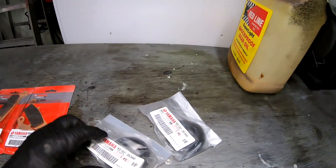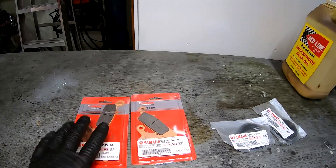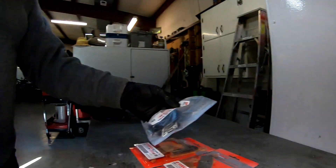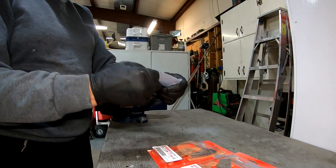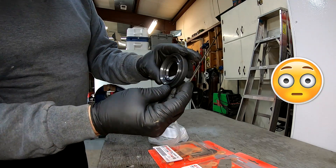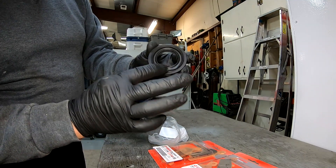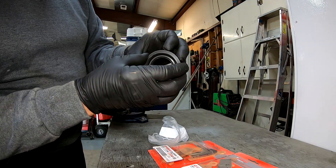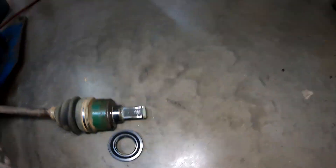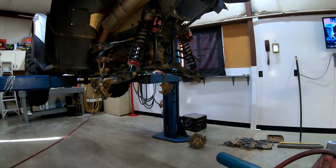Now let me show you the new ones. Here are our two new seals for the rear diff. And I also bought front brake pads — I won't do those in this video, I'll do that in the next video. Get one of these out of the package — you can see that little lip there that rides right on the end of that inner CV joint. They're rubber on the outside, so it's a pretty basic little axle seal. Let me get those old ones popped out — with no seal puller, should be no problem.